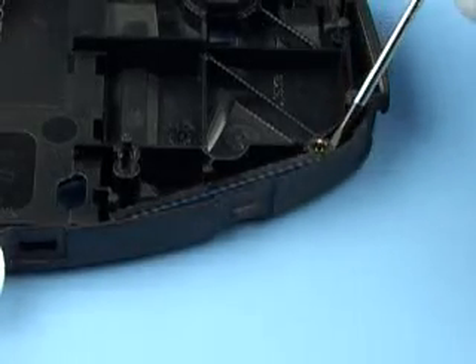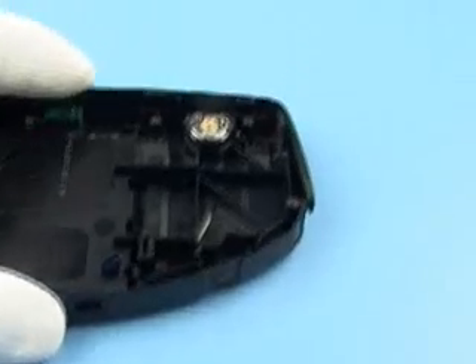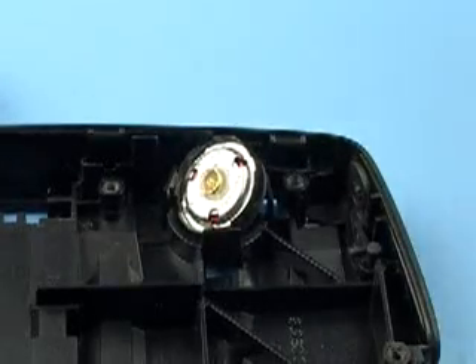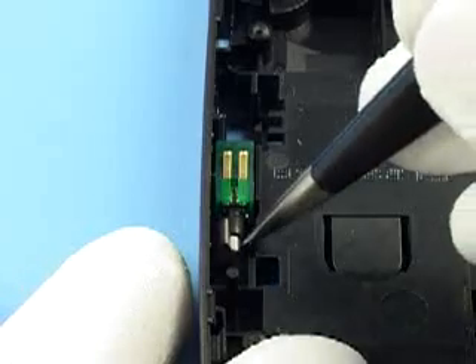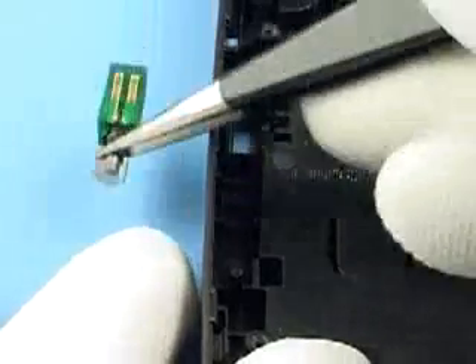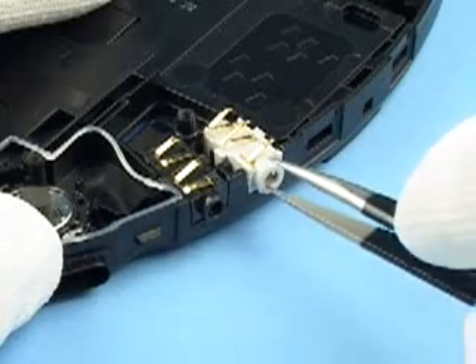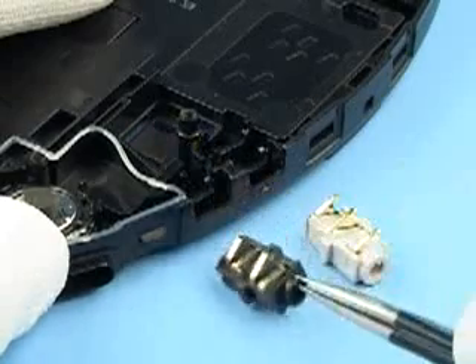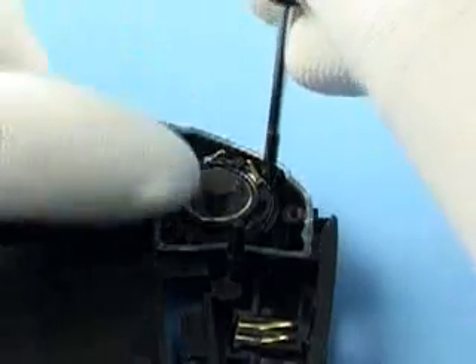Lever out antenna from the right side. Lever out speaker exactly from the point shown. Remove vibramotor. A cover: avoid damaging the spring contacts when removing the gray and the black SM jack. Lever out HF speaker carefully.